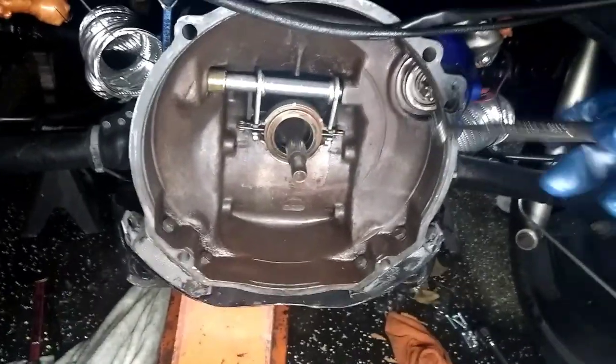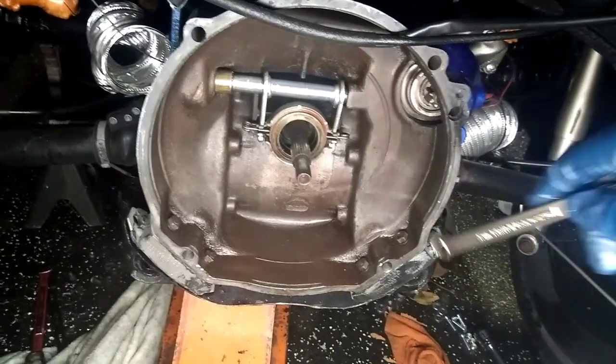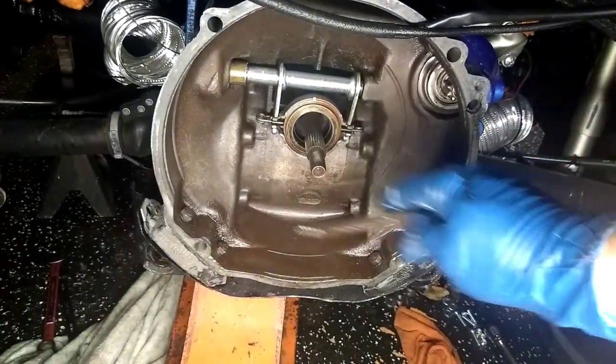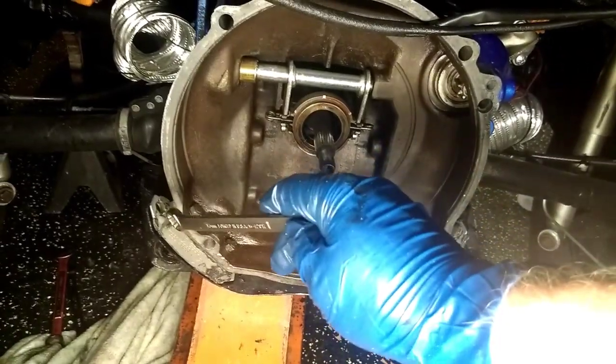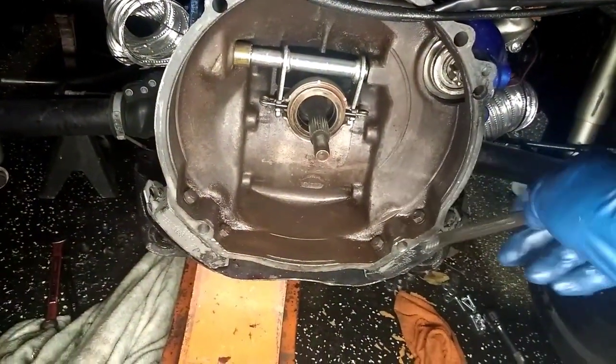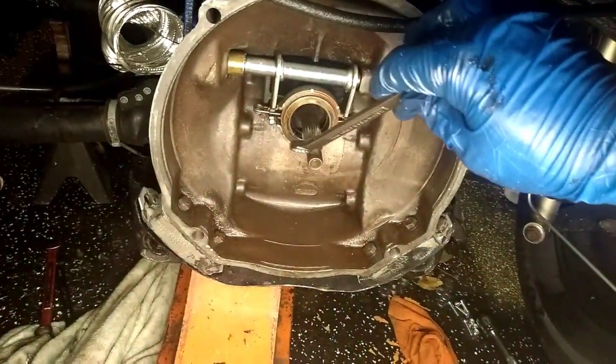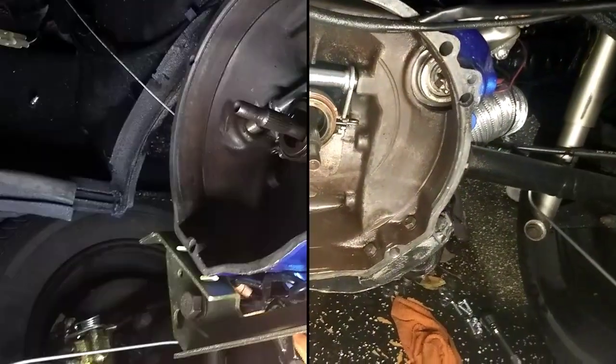So we've got our front mount on, but we're not tightening it all the way down just yet. What we're going to do is take these 4 nuts off, and I already took the 2 bolts out of that side, and hopefully the cradle should just drop out of the way and install the rear mount so that we can pull everything forward and everything should align.